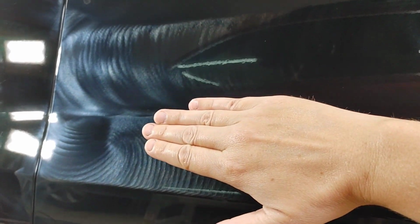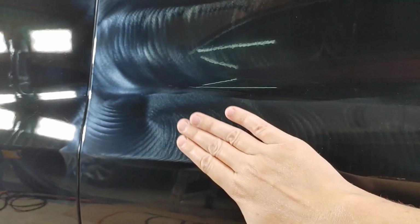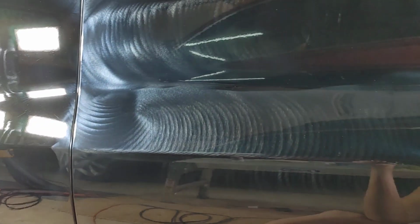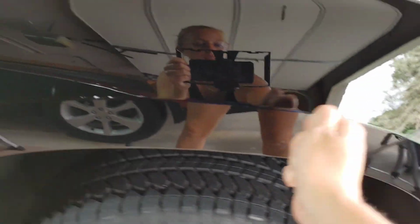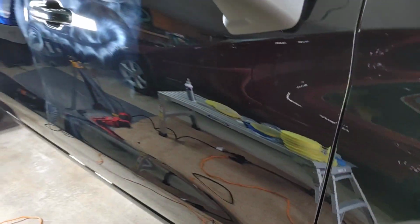You ever notice, if you have wood and you have a grain and you sand it the opposite direction, you're going against that grain and you have a tendency of creating more splinters. Not that you create splinters, but you can have a smoother finish when you go with the grain of paint. It's the same kind of mentality with car paint. Go with the grain, the way that the painter sprayed it on. If you have these curved panels over here, when he paints it, he's going to be coming this way with his spray gun. So when you polish, move this way. Try to think like a painter. Painters aren't doing this. They're going long ways and following the curves of the body of the vehicle. So that's how I polish paint as well.